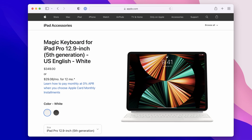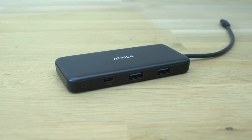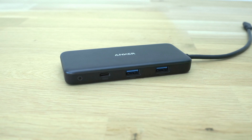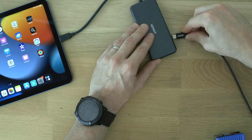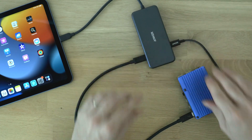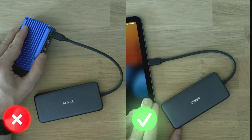The price of the Magic Keyboard always discomforts me, and I would absolutely look for a cheaper option — the best of which is to use a USB-C hub. Pretty much any USB-C hub that accepts power input will do. I bought this Anker 7-in-1 hub, not sponsored, which has USB-C power in and a USB-C data port. The hub gets plugged into the iPad, power gets plugged into the hub, and then the Pi is plugged into the hub's USB-C data port. If you're having issues, make sure that you're plugging the hub's captive cable into the iPad and not into the Pi.